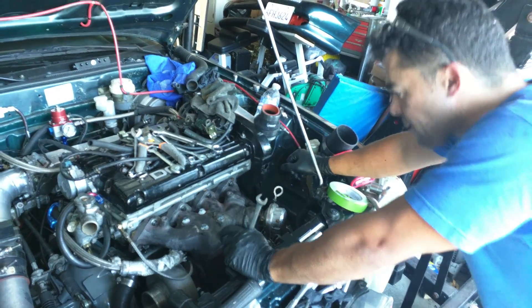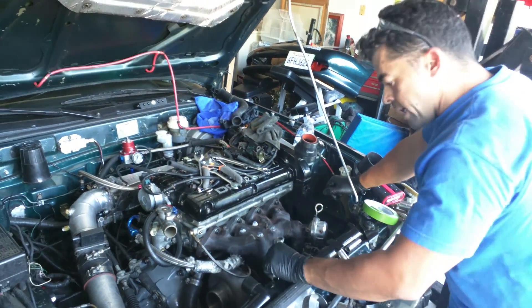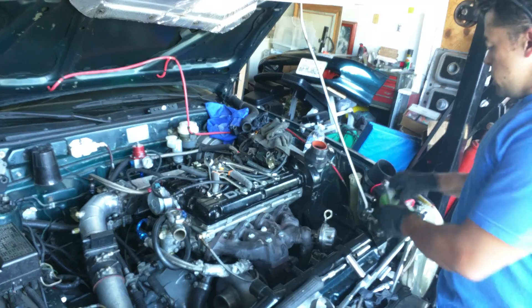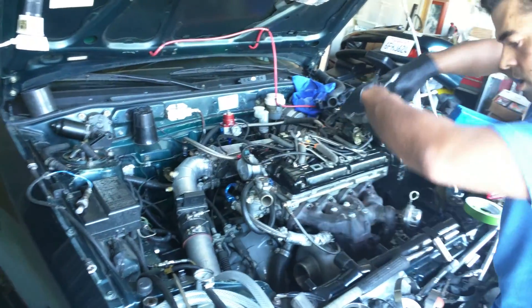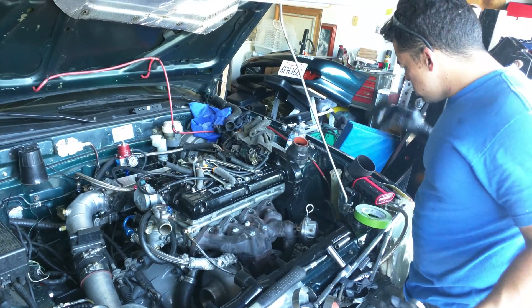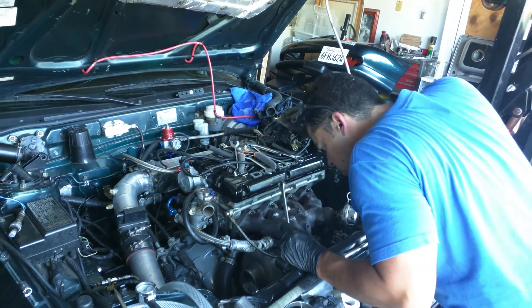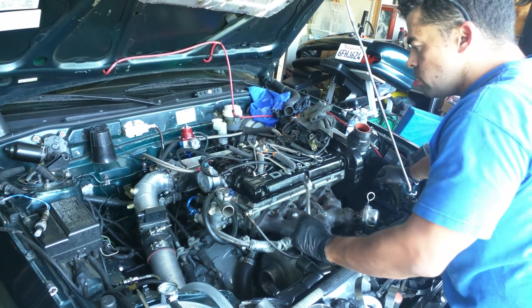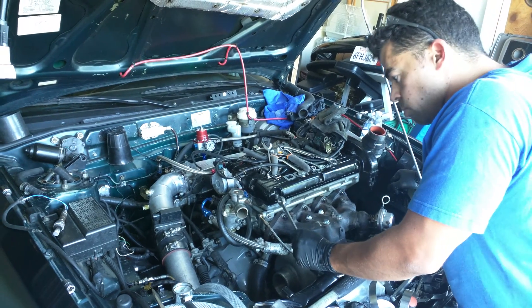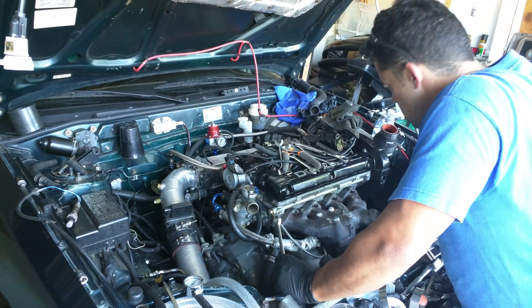The downpipe, I'm about to go and deal with that nightmare right now. Other than that, I'll put the three to three and a half inch. I'm running this GM MAF, got to put that on. All of my turbo and intercooler piping will be on as soon as I get everything bolted. After that, just a few more things to tighten down, fill up the radiator. I'll pressurize it with air first to make sure I don't have any leaks. It shouldn't. Then fill it up with radiator fluid.